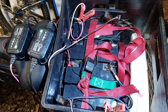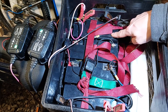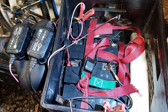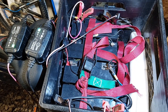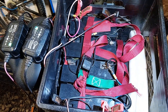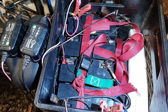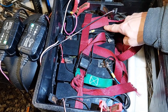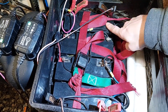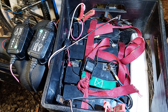I put a meter on and tested them — this one was 13 volts, another 12.9, and this one was 12.6, so I figured something must be wrong with that one. But 12.6 volts isn't too bad — the voltage was just popping back up like normal. So I did a load test: I put the meter on, engaged the motor with the wheel on the ground, and watched the voltage drop. These ones barely moved, but this one dropped down to about 8 volts. I knew that battery had a serious issue — I'd only ridden the bike about 40 times, which should be nothing.